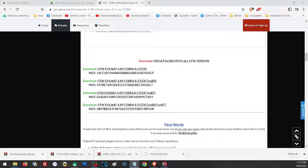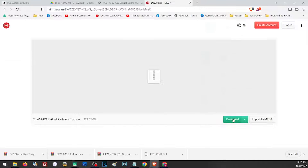If you get a Bluetooth error, you won't be able to resume the update unless you fix the error. So carefully check your PS3 first before you install any firmware. If you are on CFW, you will be able to choose a firmware that supports no Bluetooth, and you will also have an option to choose no Blu-ray drive. But if you are on hybrid firmware or official firmware, there is no workaround once you have already started your update. Since my PS3 doesn't have any issues, I will go ahead and choose this one, then click on the area and download the file.